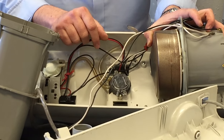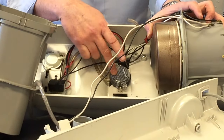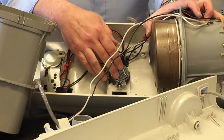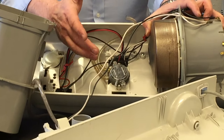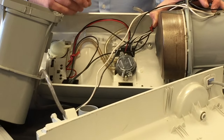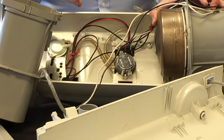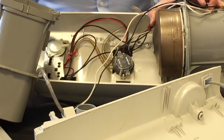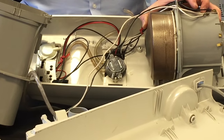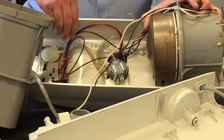The piece that usually causes problems is this lockout valve in the back right here. There are just a couple of rubber seals and some very thin plastic inside, and a lot of times what we see is this will break — and what happens is that as soon as the unit feels suction it'll just shut down and give you the full bag indicator. You can replace this part; they're available on eBay or Amazon and typically run about $35 to $40.